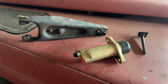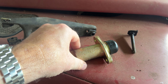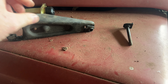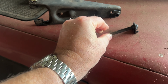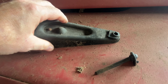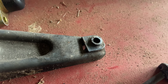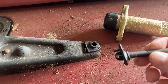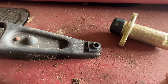Hello and welcome back to All Things Defender. Today I've got a big problem — I'm trying to change the slave cylinder on the clutch while it's all out, and I've accidentally pulled this little push rod out from the little lever. There's a small plastic clip on the back, and as I was trying to push the slave cylinder in and out to get it lined up, this little lever has come off.